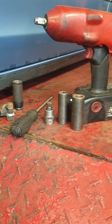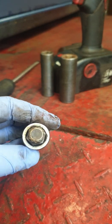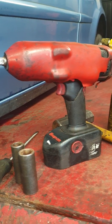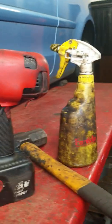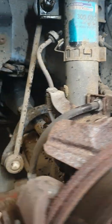The tools and equipment required for this job are: a flat head screwdriver, an M14 multi-spline, a deep 16mm impact socket, a deep 18mm impact socket, an air gun or electric gun, a hammer, and WD-40. The first thing I like to do is get the WD-40 and spray it on any of the nuts and bolts required to come off — just be careful you don't get that anywhere near the brakes.